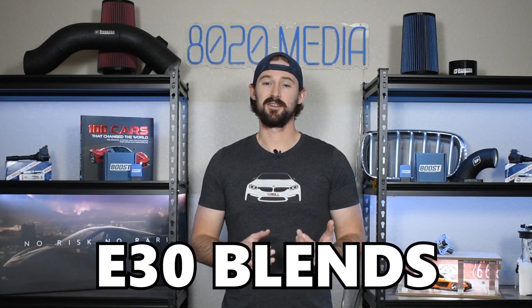Fifth on the list is ethanol fueling, or E85. The factory 2.0 EcoBoost can't handle 100% E85 without fueling upgrades, but it can run on E30 blends, and with an E30 blend and proper tuning you can get about 10 to 15 wheel horsepower from just running a blend of E85 and traditional gasoline. This is a great modification because it's essentially free — all you have to do is put a couple gallons of E85 into your tank with the proper tune. If you're pushing beyond 300 wheel horsepower, getting the fueling upgrades to run 100% E85 will deliver really big performance and power gains.